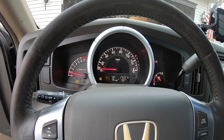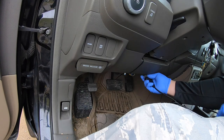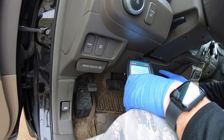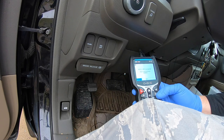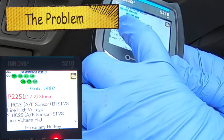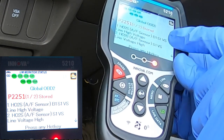The engine is running. So the next step is to go underneath and find your OBD2 scan port. You got to come down here and feel around for it, and it plugs right in just like that — it's just to the right if you have this exact vehicle. So we'll take a few seconds to go ahead and begin to read whatever the code is. So this is a P2251, and it is an oxygen sensor, an air fuel sensor. The important thing is this B1S1 — that's bank one, sensor one.